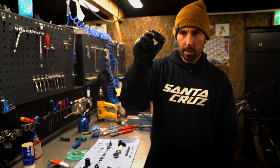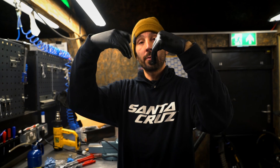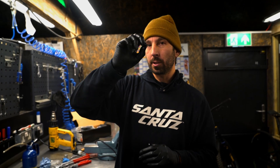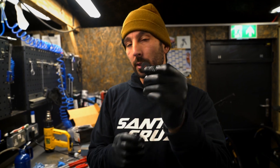There's also this curved shim on Ohlins that applies pressure to the shim stack. Most shocks have a shim lift plate where the shims reach a point that stops them over-flexing and snapping. This does the opposite — it's the other way round, like a preload. You're preloading the shim. Slightly different to other manufacturers. You can see it here flexing away — much like a leaf spring on an old truck. The stiffer they are, the firmer the spring is basically.